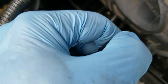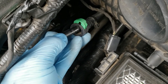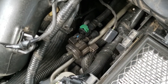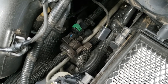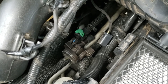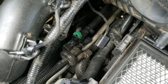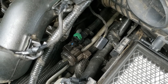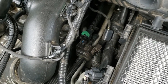What I did further beyond that as a quick test: I stuck a vacuum cap — a long one about the right size — in the hose to seal it off going to the tank so I could drive it around. And once I did that, the stalling went away and the noise in the gas tank went away. So I'm assuming I was right about the vacuum building up in the tank and releasing with that flap door in the capless gas tank fill tube. I've checked it out and now I just got to replace it.